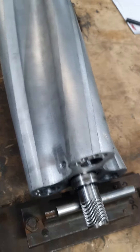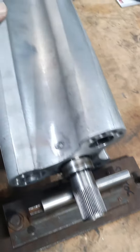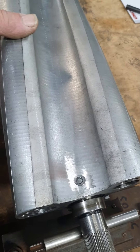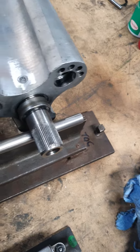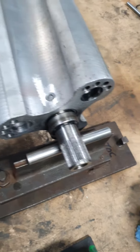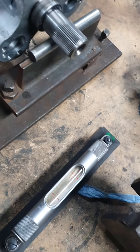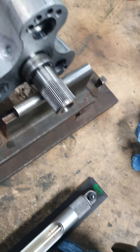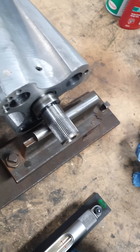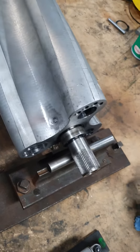In this video we're going to check the balance of the rotors for the 671. I've put another drive pin in it - the extra pin in the drive that's original - put another one on the end there. So I've just got these rails with a couple of bits of high-speed steel on them, set up with the precision level. Obviously put another pin in - that's a bit of weight - so as you can see, if you pull the rotor around, the heavy spot is going to go to the bottom.